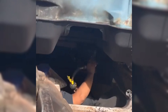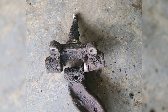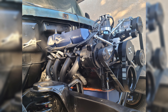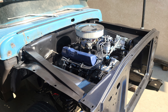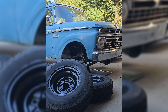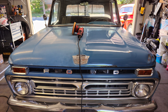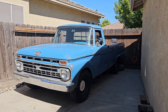Since I didn't have a lift I had to make do — just jacked up the cab so it fit on top of some blocks and went underneath to clean up the bottom end and get it ready to paint the frame. She really started to pop. Then up next was the suspension — took it all apart, replaced all the bushings and kingpins, painted it all, and it started to come out really, really nice. At that point I started getting really excited to put the engine in because everything around it was so nice and clean. Once I saw the engine inside the engine bay it was crunch time. Look — there was no cutting involved, it just fit like factory. Started cleaning the panels and fender wells, put them on, and she was looking pretty. My girlfriend even came by and helped me with the steering column. Redid the brakes, also needed new tires because the old ones were 22 years old. Went and got some Mickey Thompsons and they looked amazing — a completely night and day difference.